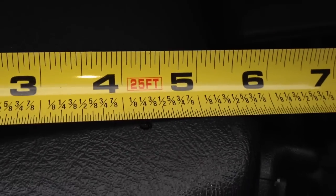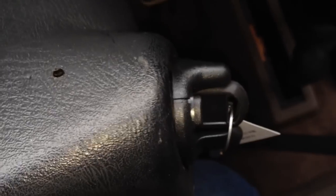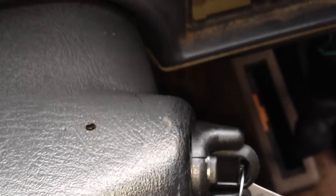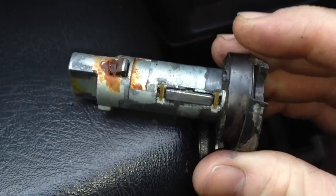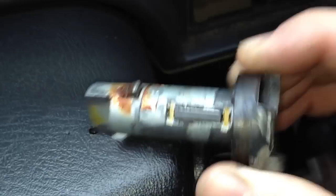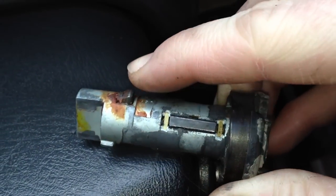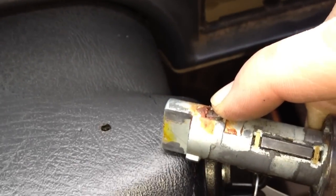Four and a quarter, dead on. You drill a hole straight down, about an inch and a half from the end of the steering column here. I can show you what this looks like — the lock cylinder ignition sits in there just like that. This is a really beat up one, which is why I took it out. This little pin here you actually have to push down on to remove it from the steering column.